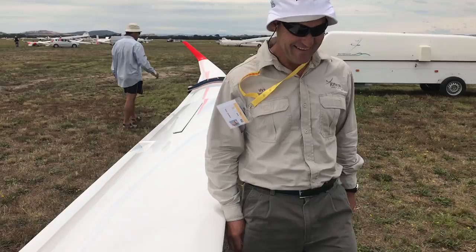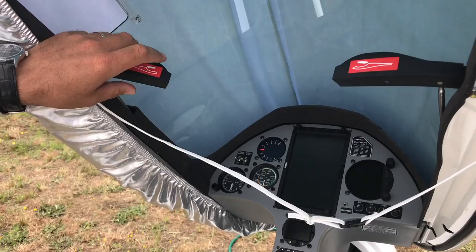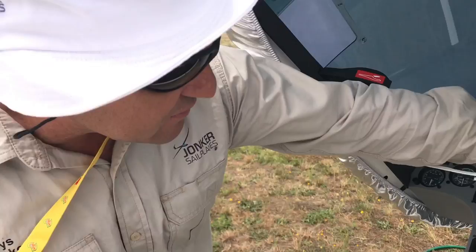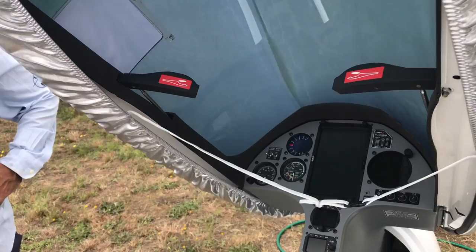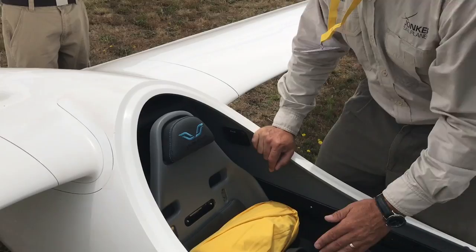It's almost done, but the canopy latching mechanism on this has some manufacturing defects. It's acceptable for now. But the springs to lock it so they don't jettison it are not installed correctly. Or it was just manufactured and designed at the same time, the last little bits. The other one's already better. This isn't the production canopy yet. And the shape of the canopy is slightly low, so you lose a bit of head space. And then the seat back needs a bit more curvature for the parachute. It needs a little bit more depth, and you have it available here, but obviously we did not realize that.